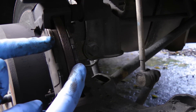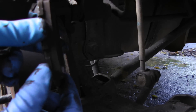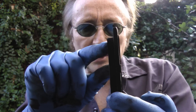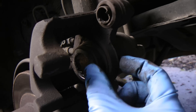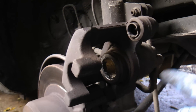In the case of this Toyota's rear brakes, you can see that the inside brake pads are real thin but the outside ones are still reasonably thick. The inside ones are almost worn down to the bare metal but the outside ones still have over 60% of their pad material left. That means the inside caliper is moving fine but the entire assembly is stuck — we can't push it back and forth, and it should slide back and forth.